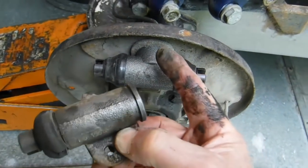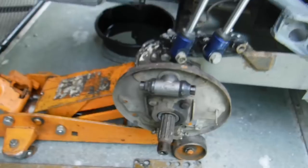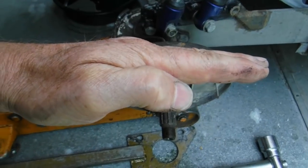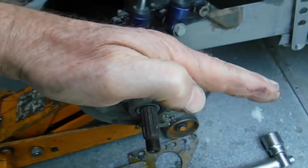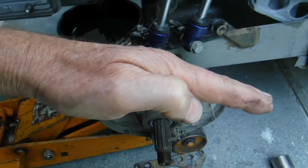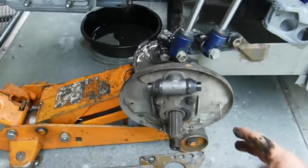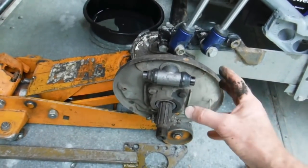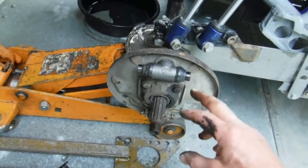What I've done is take a front wheel cylinder and put it on the back. That gives you more power because a car has bias towards the front. When you're driving and you step on the brakes, the weight shifts to the front, so your front brakes are usually doing more work than the back brakes. They make the leverage work. When you have a master cylinder, it's critical when you switch — a small master cylinder with a large brake cylinder gives you a lot of power.